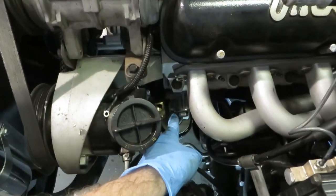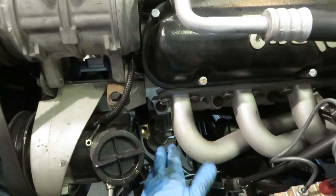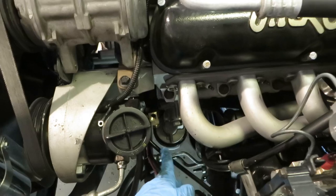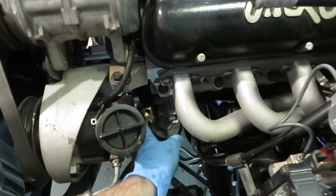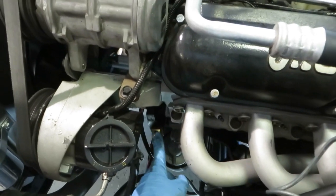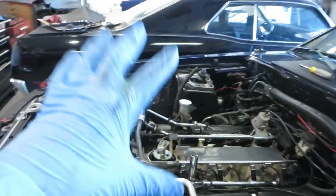You don't have to use this 90-degree filter from Ford Racing. On3 does make a kit, however they've just been known to leak, and it's a relocation kit where you actually have lines coming out and you can put it up on the inner fender well somewhere out of the way. I opted to use this, and it will make oil changes easy when the car is lifted up. You can just unscrew it, drop it, put it back in. Hopefully this spot sticks. I'm going to make sure that my oil sending unit fits right here and doesn't hit the power steering pump, which looks awfully close. If that's okay, we'll leave the feed line and run it to get ready for the turbo.